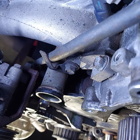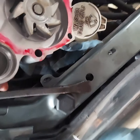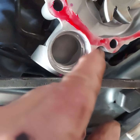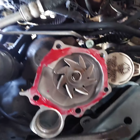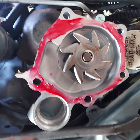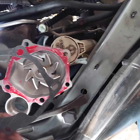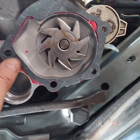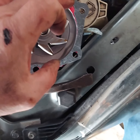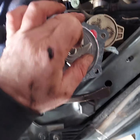Got the new o-ring slipped onto the crossover pipe right there, and here's the new water pump. Put a dab of silicone grease around the seal surface so when you slip it on you don't roll that o-ring. I like to use an anaerobic sealer around the water pump — as you can see, it's not a thick coating. The only purpose for it is to hold the gasket in place; the gasket's job is to seal it. If you have to use two inches of sealer, just throw the gasket away, because that's what sealer is for. This is just to hold the gasket so I can work with one hand.